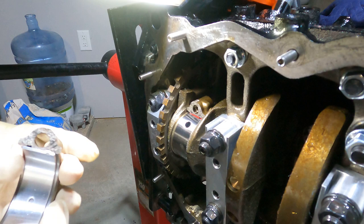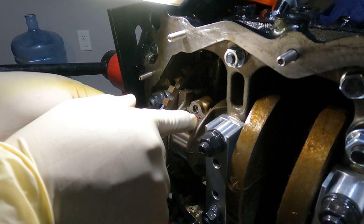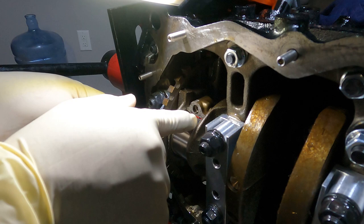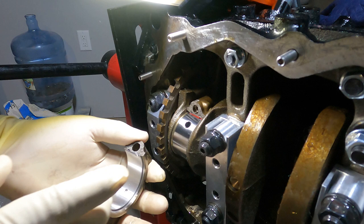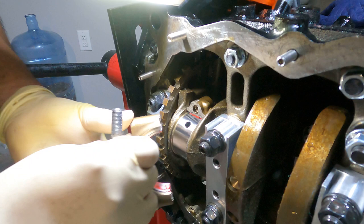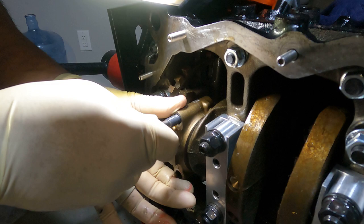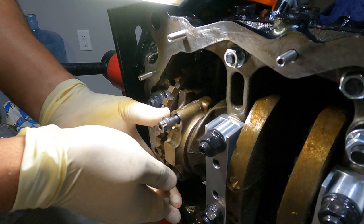Take the cap, put the bearing on the other side with lube, and put it on the crank. I marked this side so I know which way the rod cap goes — the notch here shouldn't interfere with the notch there. It's a cracked-style rod cap so it'll have the cracked mating surfaces. I numbered everything so I know which side goes where. Put the bearing in, put the lube in, and slide it in carefully, then put the ARP bolts in. You don't have to use ARP — I'm just extra.